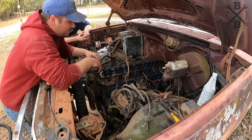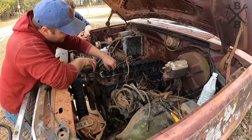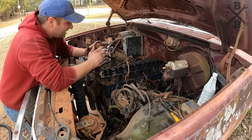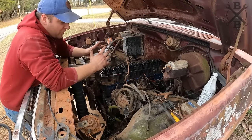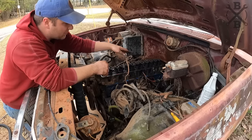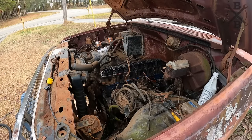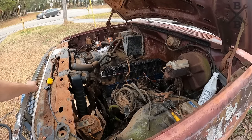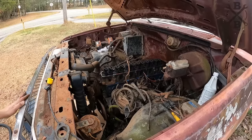Okay, so apparently I missed the part where we stuck the head on. When we did that, we just stuck our push rods in, got them lined up, set the head down, and snugged the bolts up. Now that we've done that, I'm going to throw our ratchet on the crank. We'll spin the engine over, verify our rotating assembly is working as it should, and none of our push rods got jacked sideways or anything, and then we can go ahead and torque our head bolts. Just verify, please, that all the push rods move. Looks good. Beautiful.